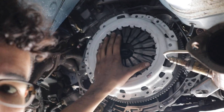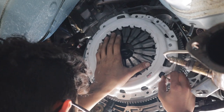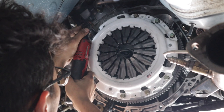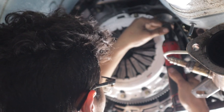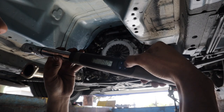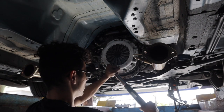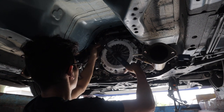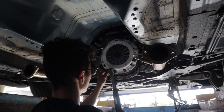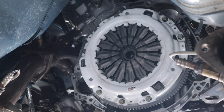The pressure plate goes on a certain way — you can figure it out pretty easily. Get your bolts, put them on. Set your torque wrench to 20 foot-pounds first, then torque them down in the same sequence. Slide the guide pin off — that's it, we're good.